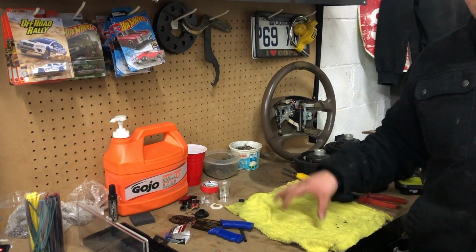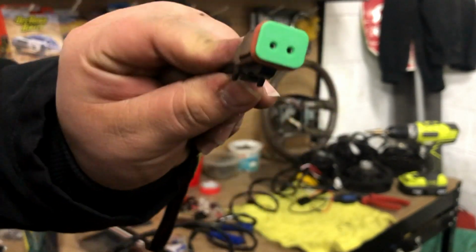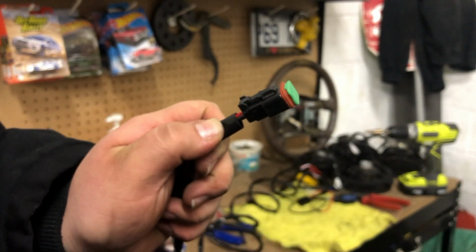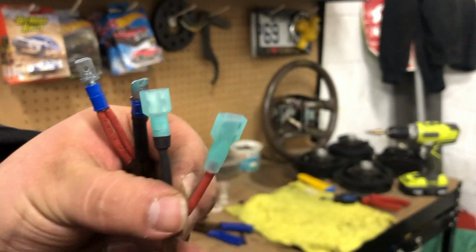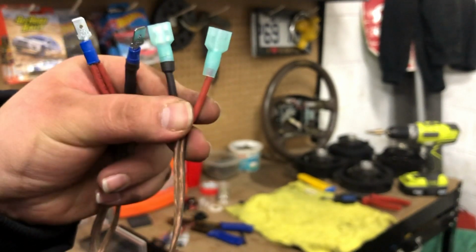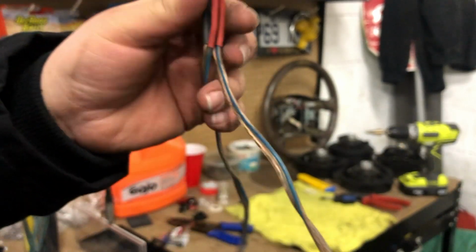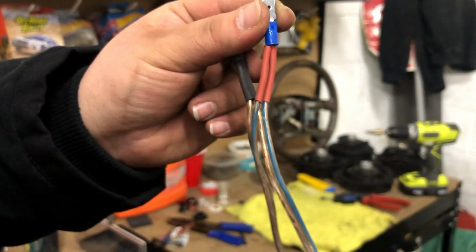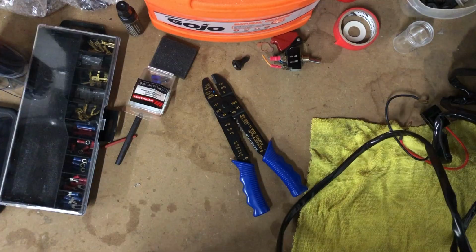I believe I've finished converting one of the Hella lamps. I did make this little harness here. This is the harness. It's all sprawled out there behind, but it's this weird plug. I cut these off, and then put on some spade connectors to make it work with the lights I got going on here. Essentially, I made extensions, if you want to call it that. Adding this wire, so female plugs there, follows to here where it gets spliced together to the other one for the other side, if that makes any sense. But I think you'll get what I'm talking about when you actually see it together.